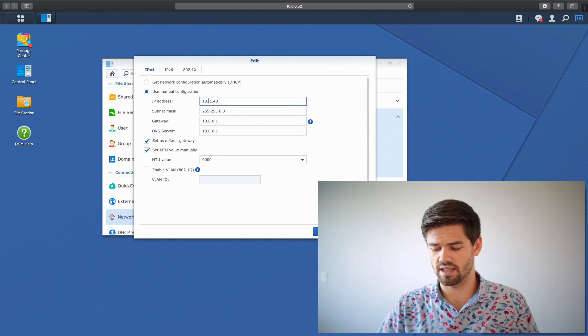All we have to do is click OK. It's giving us an error that we actually need to have a valid gateway and valid router, even though these are never going to get used because we're setting up our own configuration. Also, it's actually going to force us to do an MTU of 1500, though you can change this once we're connected. Synology does a pretty good job of making sure everything's compatible before allowing you to go willy-nilly with the MTU, which is a good thing.